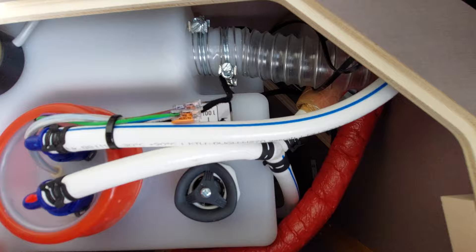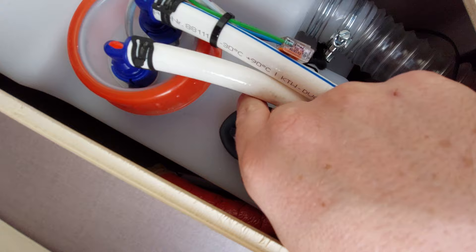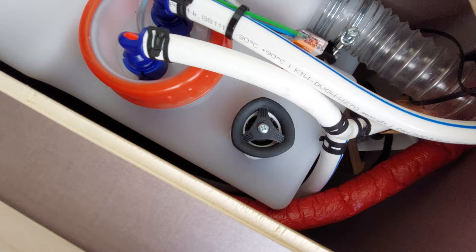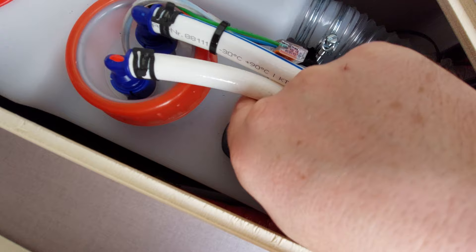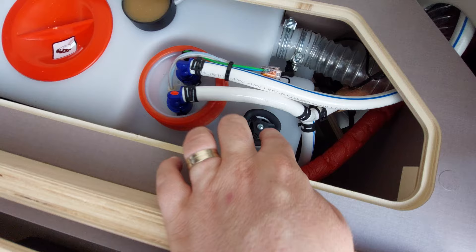This little wheel, as the sticker says, will allow the tank to either go up to 100 litres or 20 litres. You empty it and fill it up by turning the wheel. If we turn it anti-clockwise it will enter; if we turn it clockwise, one turn until it clicks, it will fill it up to 20 litres and then overflow. Keep turning it through until it's finger tight and that will fill it up to the full 100 litres. To empty it, you do the opposite — the first click does 20 litres, keep going and it will fully drain the fresh water tank.